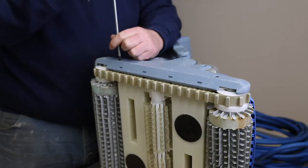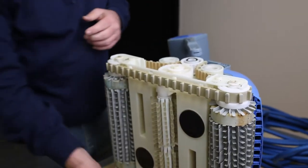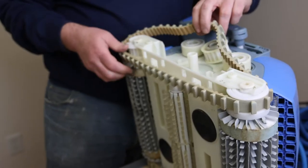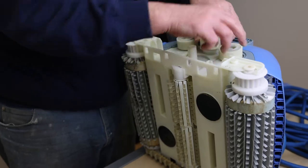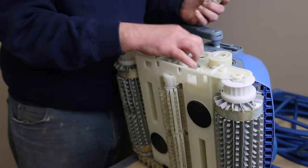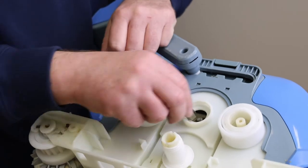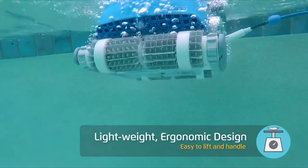Replacing the robot's tracks involves removing the side plate using a screwdriver. You can then lift the track up over one of the guide wheels using the screwdriver for leverage if needed. Remove the guide wheels and the pulley. You will also want to see if there is a hex pin inside of the pulley upon removing it. On robots with dual drive motors, there is a hex pin on both sides, and only on one side for single drive robots. This is dependent on the functionality of the robot.